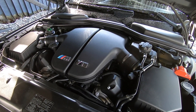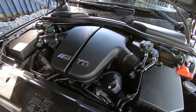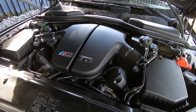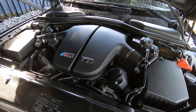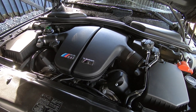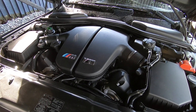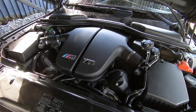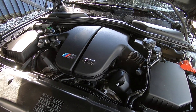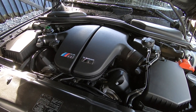It's not often that cleaning alone will solve Vanos performance issues, and honestly, if you're going to all that trouble, you might as well just replace the solenoids themselves — especially when the car is at this kind of age. The solenoids can also just begin to fail over time due to the nature of a solenoid valve; they can become lazy or stop working altogether. Any time you remove the Vanos solenoids, keep in mind you're introducing air into the system, so once refitted, you'll need to run the Vanos bleed procedure with the relevant software. Once you've bled the system, follow it up with a Vanos performance test to confirm everything is as it should be.